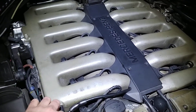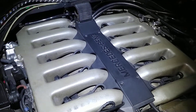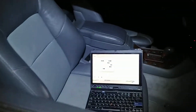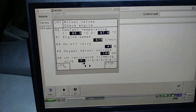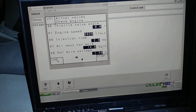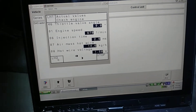Again, this is about freezing temperature. The engine runs really, really nice, so I'm going to leave it at that for now. Let's take a look at our readings — that's very important. LH1: I have an issue with mass airflow sensors; I feel like one of them is reading less than it should, but they're reading.